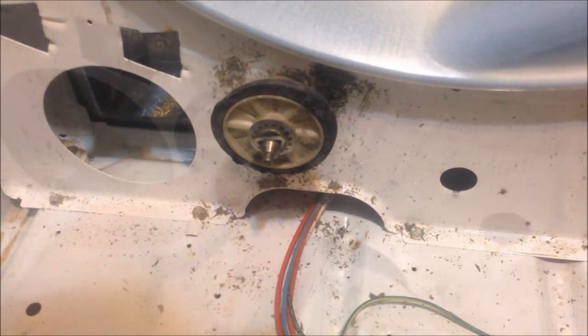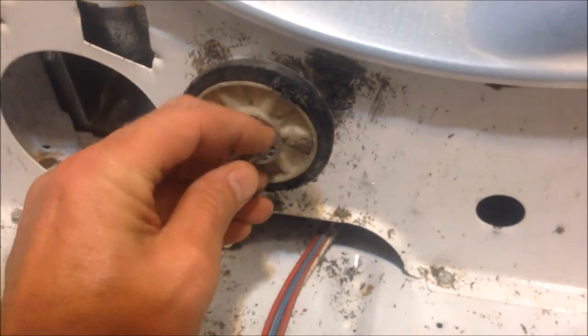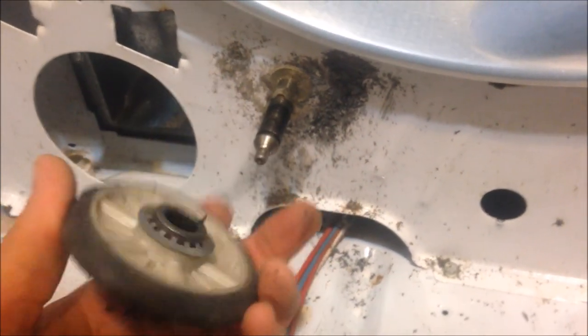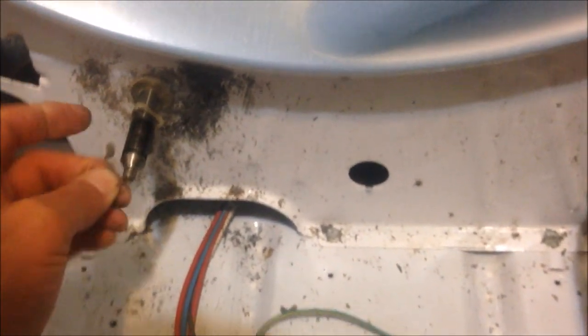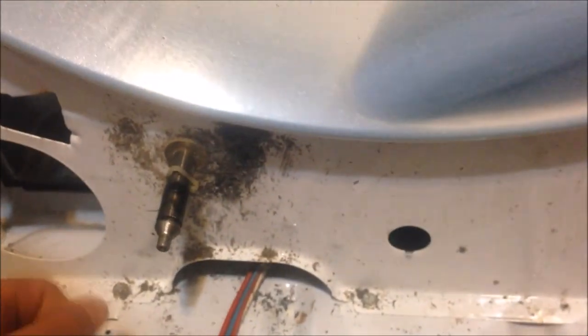The wheel will come off after you get that. Take your wheel off — that entire assembly will be replaced. We're going to clean all the lint, hair, and burned up metal off this shaft because I want it to be a smooth surface for the new wheel to ride on. We'll do the same thing over here: pull this clip off, pull the wheel off, clean that shaft up, then we'll put the new wheels on.